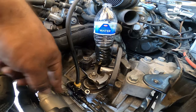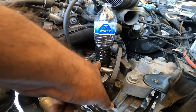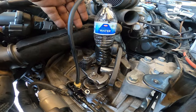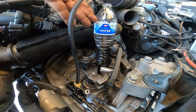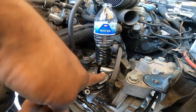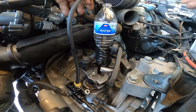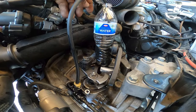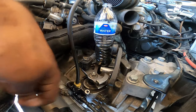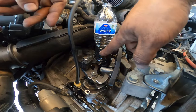What you're going to do is crack the valve open. Then, if you want, fill the water bottle up with about a quarter inch of fluid. If you're doing this by yourself, you're going to need to listen — hopefully you're in a quiet area, because you won't be able to see the bottle from where you're at. I used my GoPro camera with live mode so I could see the bubbles come up. You're going to pump the clutch for about 15 to 20 seconds, and then it will fill up and the bubbles should stop.